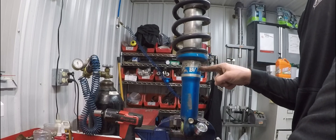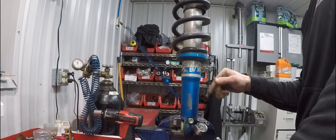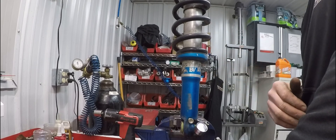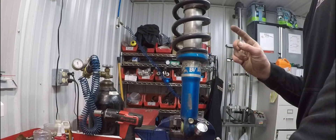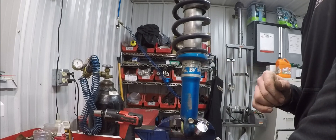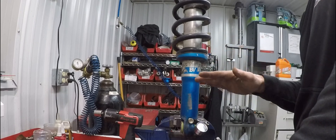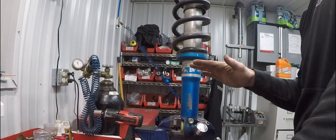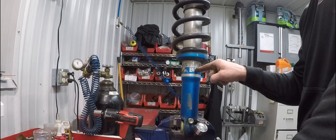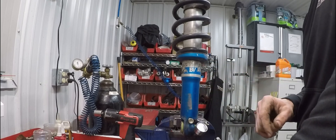There's a lot of misinformation out there. A lot of guys think you can run gen ones at 200, but that is not the correct gas pressure. The gen twos are 200 in the front and 150 in the rear. We here put 200 in both front and rear on gen twos and everybody says it rides great, rides like new. On the gen ones we put them at 250. This base valve right here is what allows you to run a lower gas pressure in your gen twos — the gen ones do not have a base valve.